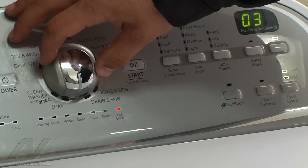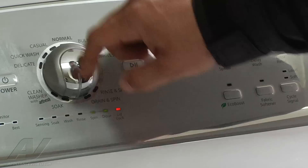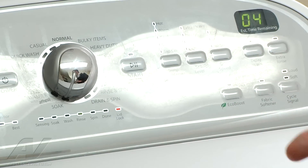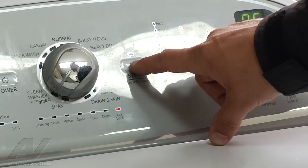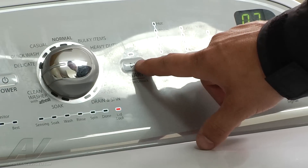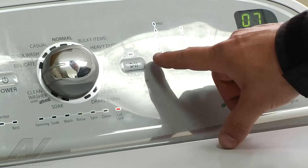I know it's not in the beginning because that's when it fills with water. I just advanced — right now I'm on number four. Each time I turn this it's a basically a different number. We're going to hit start. When it flashes like that, it means that test number isn't used. So that's no good for us. We're going to hit five — we're filling with water; we don't need that. Let's make it spin — I'm going to pause it. We're going to go to six — it flashes, not used. Seven — it's draining out right now. In order to make it spin we have to have the water removed anyway. So I'm going to make sure all the water I just put in there is removed. By the sound of the pump right now I can tell the tub is as empty as it's going to get. We're going to pause it.